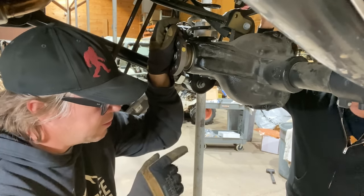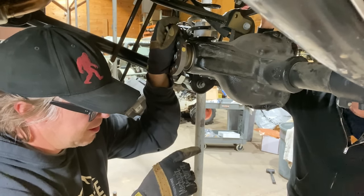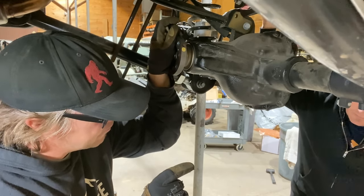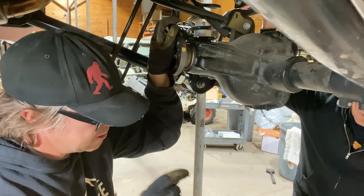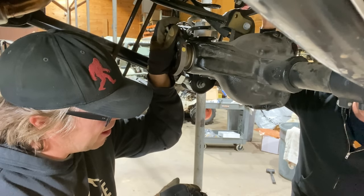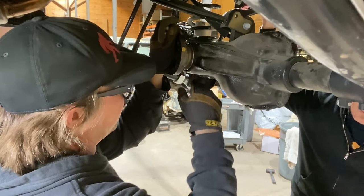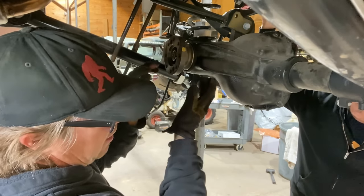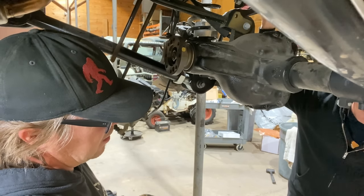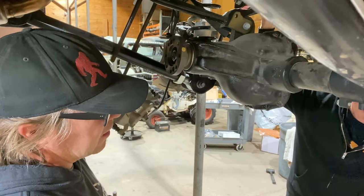So, on the Mopar Ultimate Dana 44 that's in the front of Noob Sock, I think it has two fill plugs, and they literally said use the top fill plug the first time you fill it, and then use the bottom fill plug every time after that, because the first time it'll launch oil up in there and it would hold oil. Yeah, I would bet the first time it's actually high enough to get to the valley. Into the bearing. That gets to the bearing. So kind of doing the same thing.